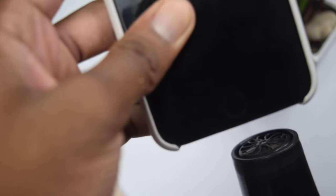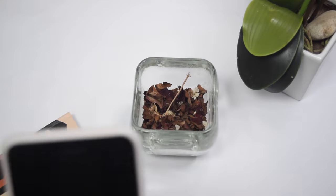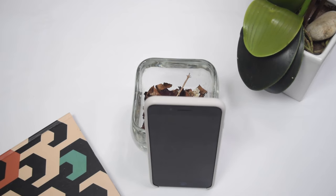Perform this for a maximum of five minutes. Once you're done drying, get an object to support your phone and keep it in a vertical position so that all liquid and moisture can slide down from your iPhone. Keep your iPhone in this vertical position for 10 more minutes. In total this process takes 15 minutes: the first five minutes drying with the hair dryer, and the next 10 minutes leaving your phone vertical.